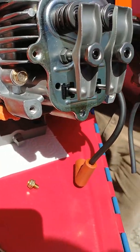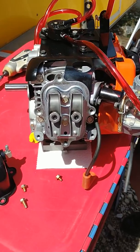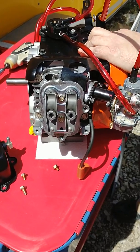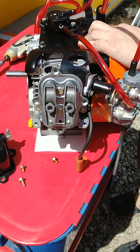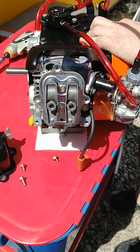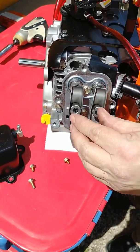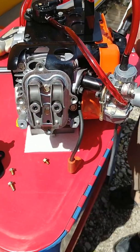So that's pretty much it. We'll go ahead and double-check our work, because sometimes people get confused on where to set top dead center since the piston is at top dead center twice in a four-stroke — once in the overlap cycle and once on the compression cycle. As we pull this over, we'll see the exhaust open first, then the intake as the exhaust closes, then our exhaust compression release, and we're back to top dead center for the second time. Note again where your crankshaft is. We still have valve lash on both sides — we're ready to put the valve cover back on and go race.